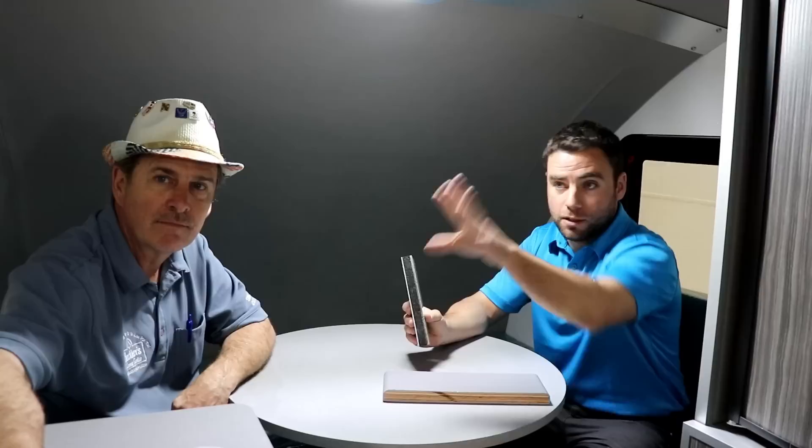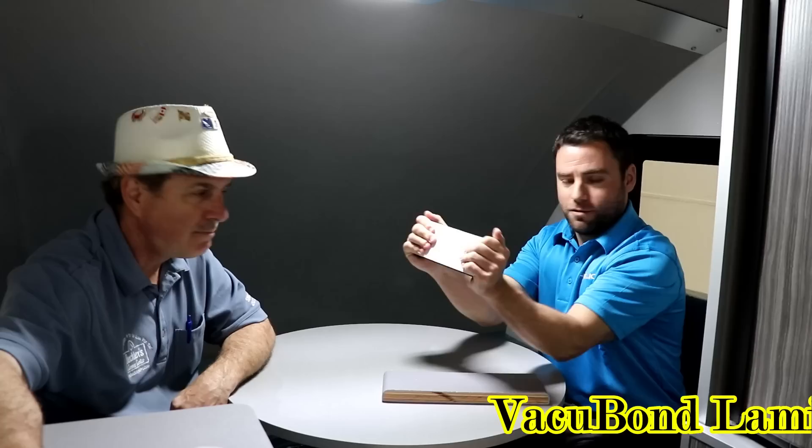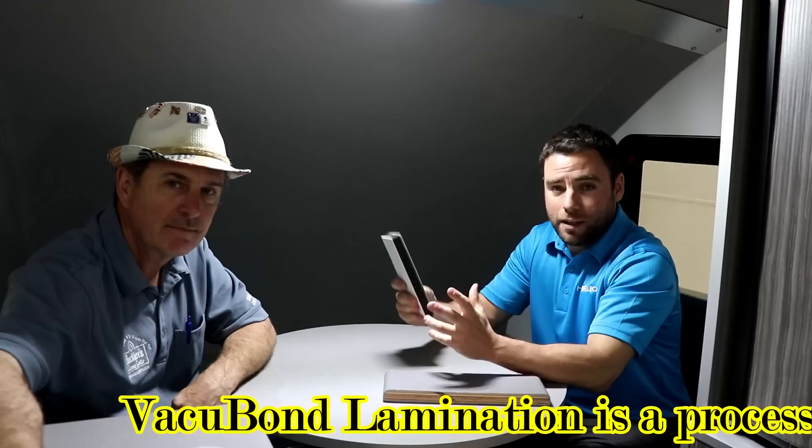The things that we do, we fix all the issues that you can have from a travel trailer. So it's a fully molded unit. We don't have big windows on the back or on the front because we don't want water leaking inside your trailer. In Canada we have different conditions — a lot of salt, a lot of sand on the road, and a lot of ice and snow in wintertime, so we always get water infiltration. It's a fully molded trailer, all fiberglass. You don't have wood inside, no skeleton in the structure — it's done like a boat shell. You get gel coat for the color, it's infused so the color is not going to change over time. You get the foam — it's a denser, really strong foam — so the structure is ten times stronger than a typical trailer.